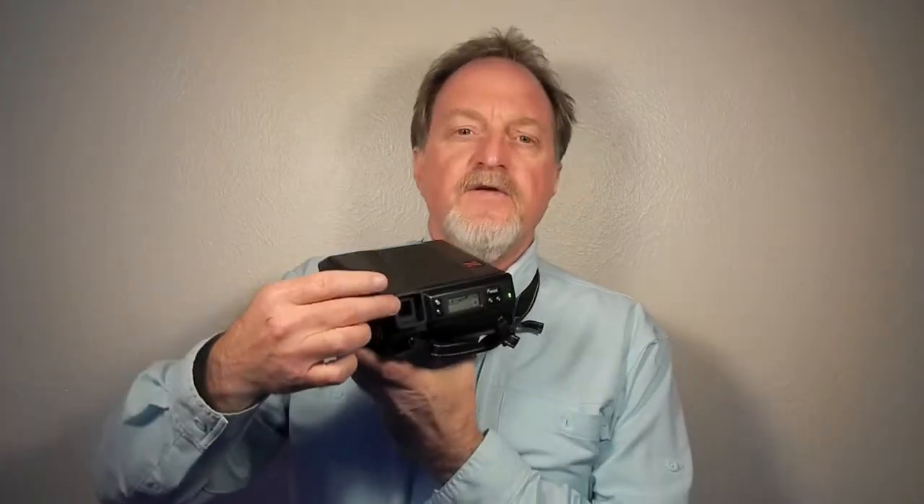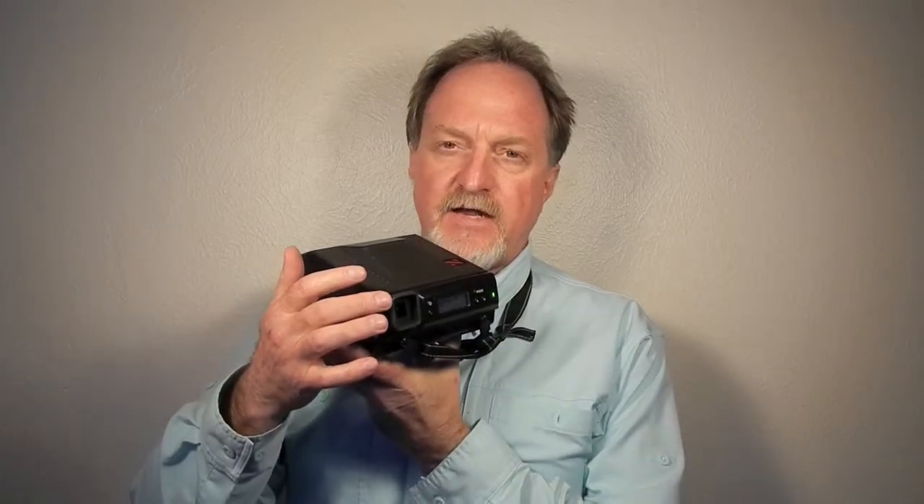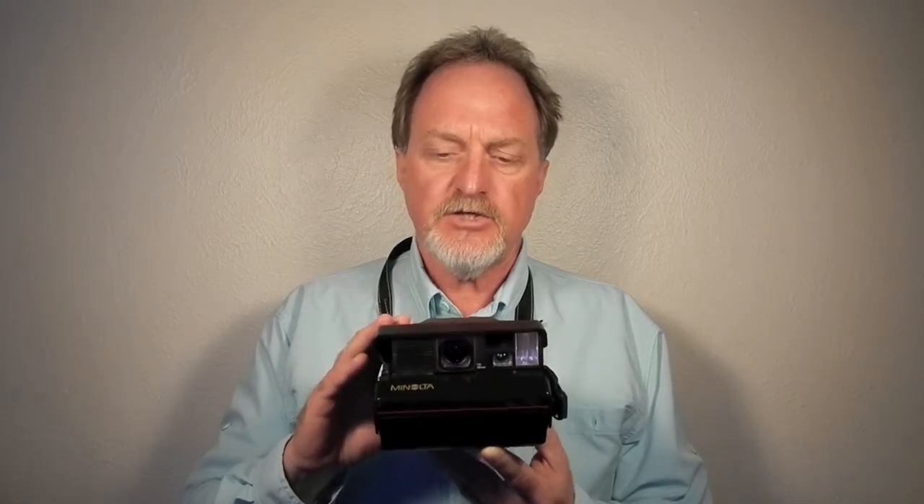The viewfinder has a lot of good information in it. It shows the actual distance according to the ultrasonic rangefinder, and with that and the yellow and green lights, it'll show you if you're too close, too far for the flash, or within the flash range but with the flash disabled by the control panel on the back. You can also turn off the ultrasonic autofocus, which is really good for shooting into water or through glass — things that completely confuse ultrasonic rangefinders.